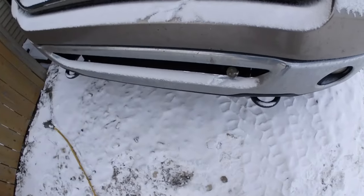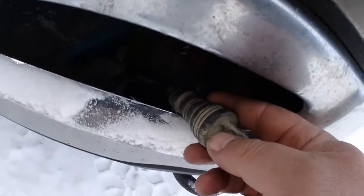Welcome to today's video. We're going to do a test of my block heater to see if it's working. It was minus 26 degrees out this morning, the truck was plugged in, and it seemed to have a little bit of trouble starting. So we're going to put a multimeter on the block heater cord to see if the block heater shorted out or not.